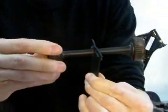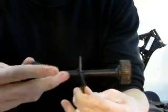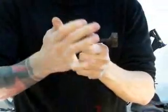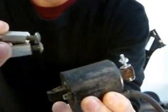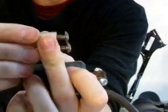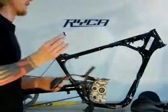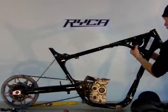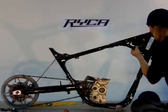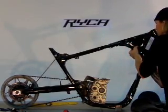The first step is mounting the new dropped tank bracket. Your original rubber mounts will mount onto our modified tank bracket — slide those over the end just like you would on the stock mount that you cut off. This bracket mounts in the original coil location below the original tank. We'll use the risers from the original coil as a nut on the front side, with screws through the back side, tightening the risers down on the opposite side.